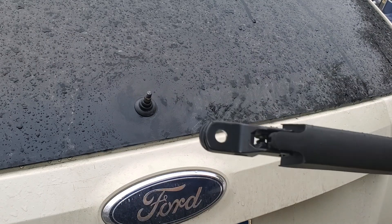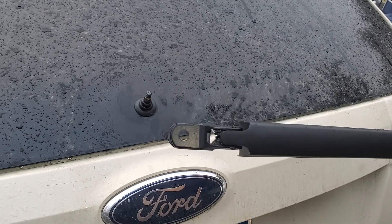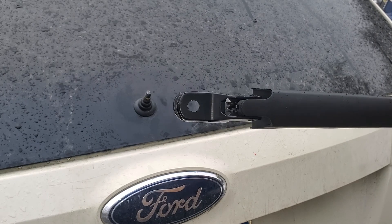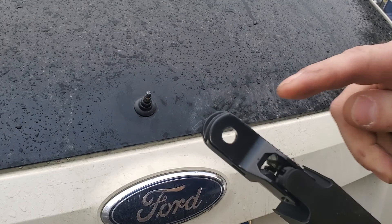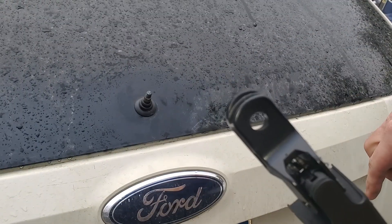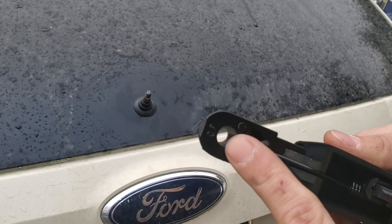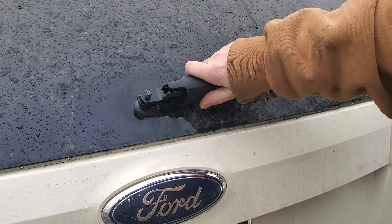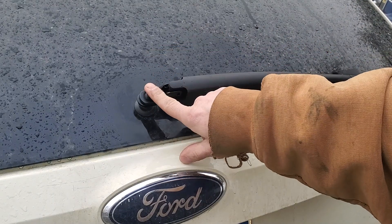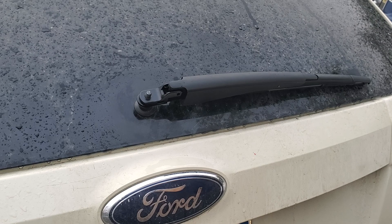When you purchase the replacement, it'll run you anywhere from $12 to $13 — unless you go to the dealership, then it might cost you $30, $40, $50. This replacement doesn't have the metal ring on the inside of it, but I'm not too worried about that. The reason is because this little piece here, instead of being plastic like the factory with the steel ring, this is actually an aluminum casting. The metal is already built into it. When I start cranking on the 13mm nut, it's actually going to push and press it down onto those splines and cause the groove you need to operate this.